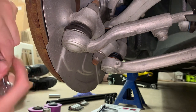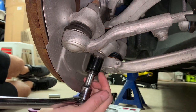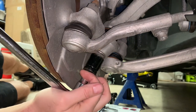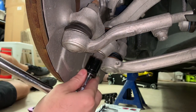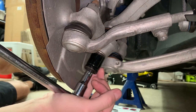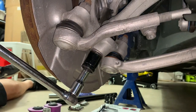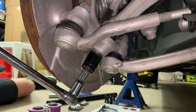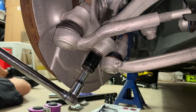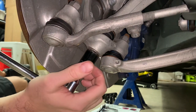This car's only got 11,000 kilometers on it, but you can already see rust on those ball joints — they're obviously not the same grade metal as the rest of it, which is disappointing. Hopefully I can just turn the nut without holding the joint. I need a deeper socket than that — there we go. Pull it out a little bit, and it looks like turning the wheels will help.